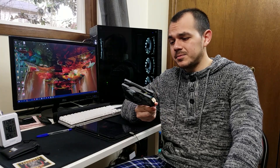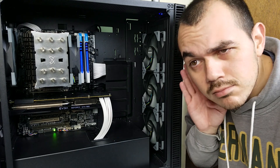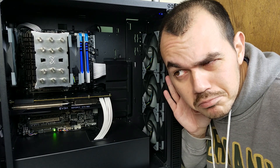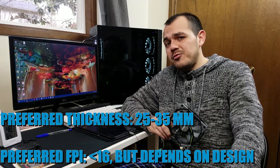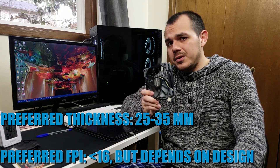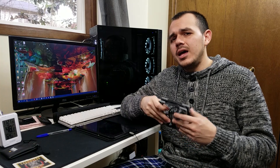So let's go ahead and summarize my thoughts. It has really good build quality for the price — it's not super fancy, but I don't think it was trying to be. It operates quietly across its entire RPM range and really functions well as a case fan or an air cooling heat sink fan. For radiators, you're going to want to stick with a slimmer profile, low FPI count radiator if you're going to use it for that purpose — but even then it's not terrible, it's just not meant for a really high-performance water cooling setup. It's meant more for something where you just want things to be low profile and quietly operating without adding a lot of bulk to your case.